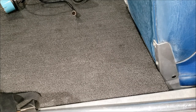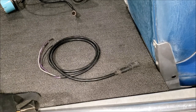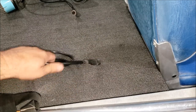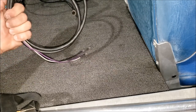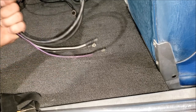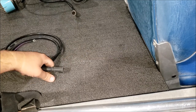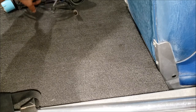First and foremost to do this project, we're going to need a tachometer harness - this little plug with three wires coming out. There was an aftermarket company making these; they're no longer available from the dealer, but you can still find them used and usually in pretty good condition. Even if it's all gray and sun-beaten, the rubber is so thick there's usually still plenty of life left in the harness.